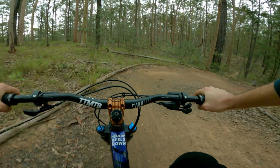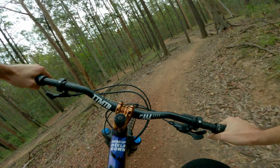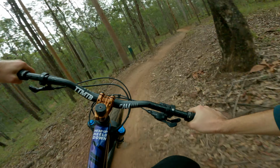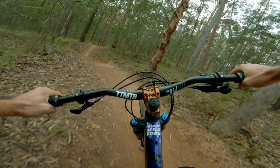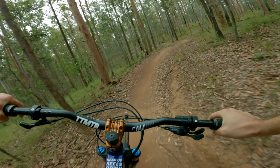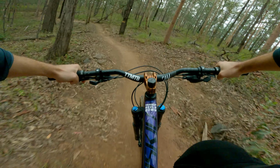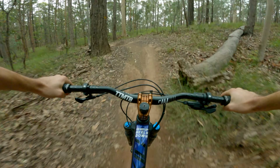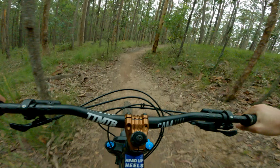So I definitely noticed there was a little less confidence leaning the bike over. Sometimes I noticed that the transition was a bit too much and I lost a bit of confidence there. And secondly, when I noticed on the rear that the edge knobs fell away a few times, that was amplified up front as well. So really pushing the front end into corners, leaning it over, that happened a bit more frequently. And I really like those edge knobs to stand up tall and strong as you push it into a corner, and I just really couldn't trust the front end with this tire on the front.